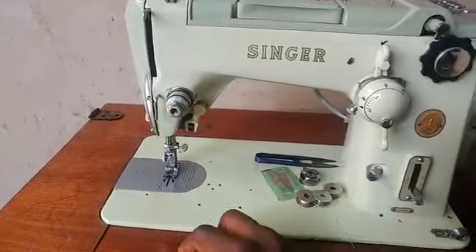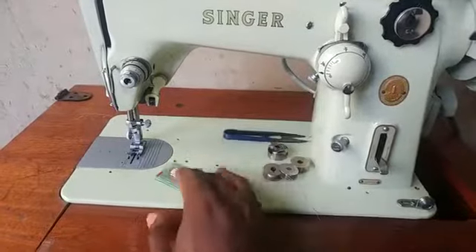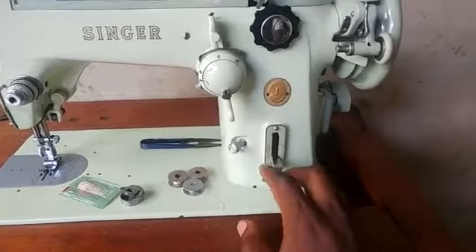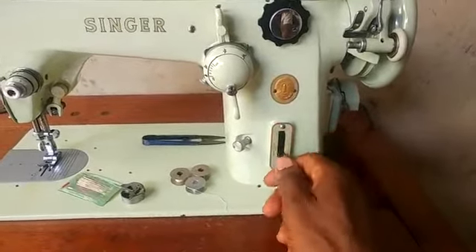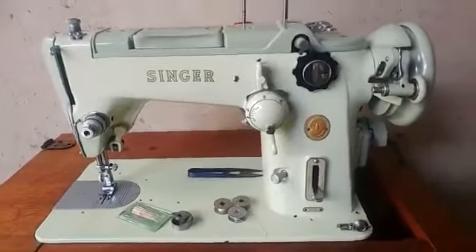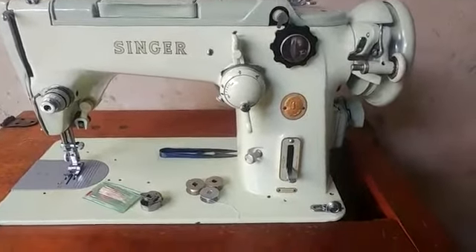Right here you have the tension. It uses the HA or DB needle types. It uses the industrial shuttle and bobbin mechanism — we have a couple of shuttles and bobbins here. This lever controls the stitch length regulator; once you go beyond the zero mark, you're sewing your backstitching. It comes with an electric motor easily fitted at the back, and a light bulb for night sewing. However, for this video I'll be using the treadle, which is the manual part of the machine, as most of my customers and viewers always request that.